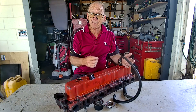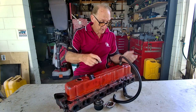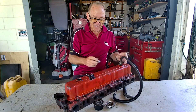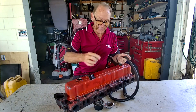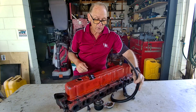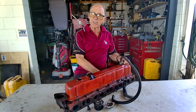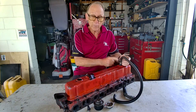You have to be careful to fit the right PCV valve with the correct part number for your motor. There are a couple of different types. On an early Holden the tappet cover only has the oil filler entry and the PCV valve entry. This early system uses a right-angle valve. This is actually the wrong valve for this cover because it's too tight to fit. The early Holden system — Holden was the first — and in 1972 it became mandatory under ADR 27. Earlier models just had a stub that came out and went straight down beside the motor, venting all the fumes straight to atmosphere. With tighter pollution regulations, the PCV valve was introduced to redraw those fumes back into the motor and re-burn them.